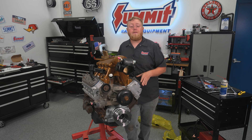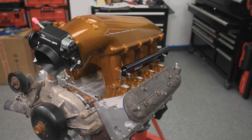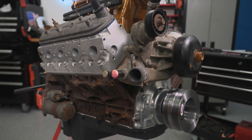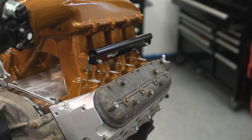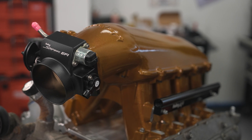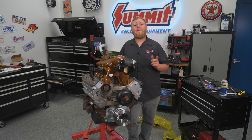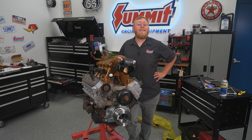I have a couple other odds and ends to hit, like hanging the rest of the accessory drive, manifolds, injectors, some general stuff — steam ports — but I'm not going to bore you guys with that. This combination here with the six liter and the big Torquinator cam should make about 400 horsepower, and it's going to make this F100 a ball to drive. We went ahead and addressed some key parts like the rockers, a good oil pump, and a good timing set that's really going to make this thing live a long, healthy life. Make sure to like and subscribe to the Summit Racing YouTube channel so you don't miss out on any content, and punch that notification bell as well. I'm going to get the rest of this thing buttoned up so I can get it in the truck. Until next time, I'm Justin with Summit Racing — thanks for watching.